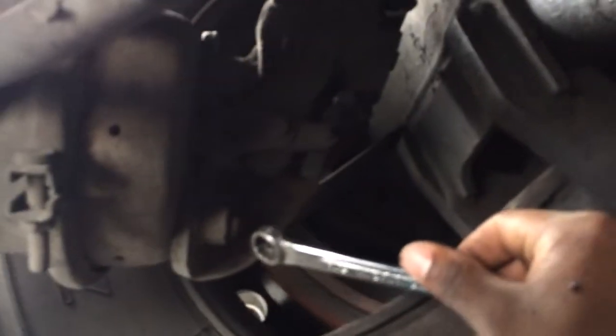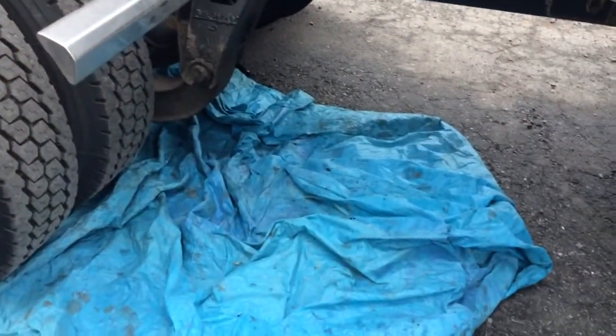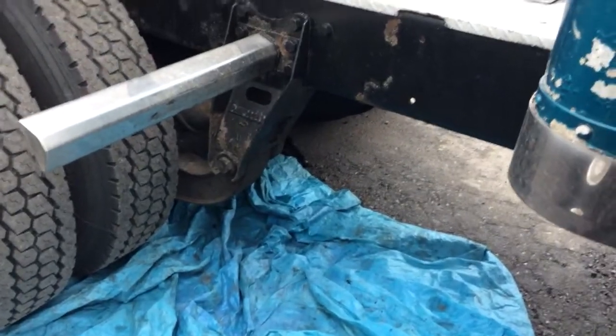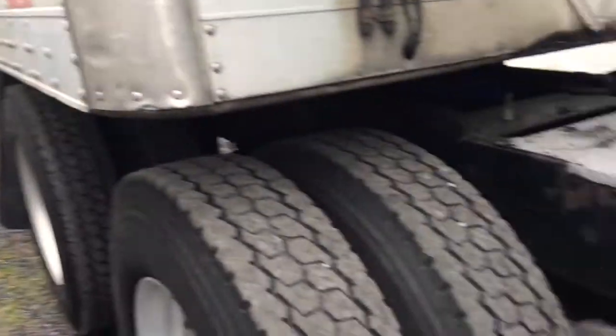Let me go through the steps again. Number one: build up air pressure in your tanks. Then release the tractor brakes after your wheels are chocked so it won't roll back. Then tighten that bolt down — if it won't move it's already good; if it keeps turning, tighten it down and back it off a quarter to a half a turn. Technically you need a certification to adjust brakes, but hopefully this shed some light on it for you.